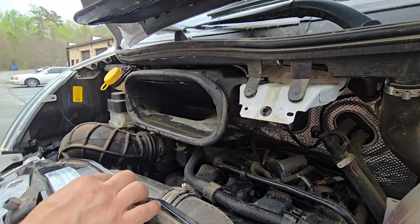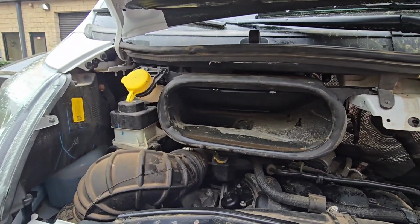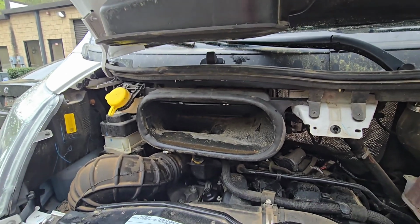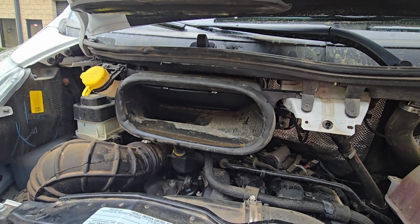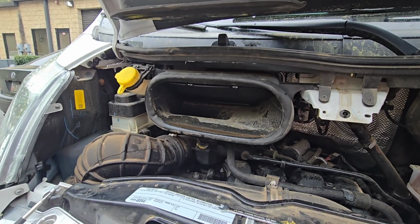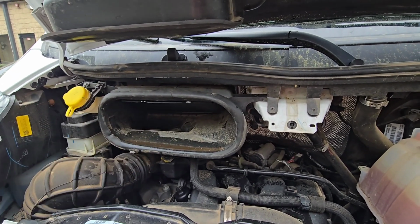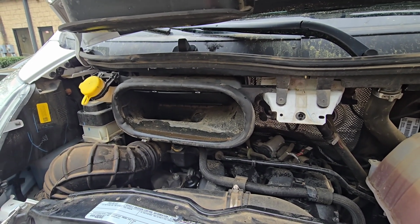So you see the whole thing. I'm not going to waste my time anymore. It's just 2 bolts and you change the air filter, or this is the cabin AC HVAC filter. And again, remember, you're supposed to replace these every 10,000 miles. I would say probably once a year or even twice. Probably the best time would be to change this after the pollen season, right after the springtime, somewhere around the summertime, and you enjoy the weather outside and you change the filter. So 2 bolts, you take it out, you install the new one, and this is the whole job.